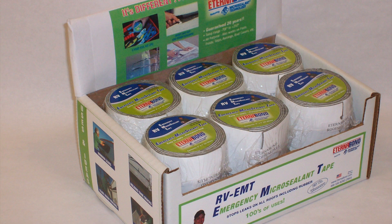Another thing you can try, once you gain access to where the actual crack is, is to patch it using EternaBond tape. EternaBond is a great aftermarket product used for many different functions. I've used it to seal anything attached to the roof — seams, vents, opening vents, reefer vents, anything attached to the top of the RV. It's also available to plug holes underneath the coach to keep critters from crawling up inside the floor. Every RV handy person should have a roll in their toolkit. Make sure the side of the tank is very clean and dry, the content is below that level, rough it up with some sandpaper, and then apply the EternaBond tape.